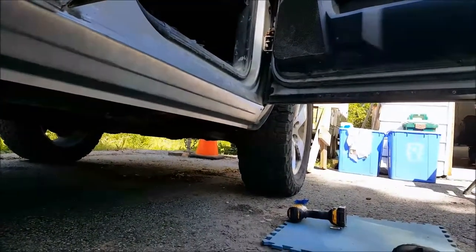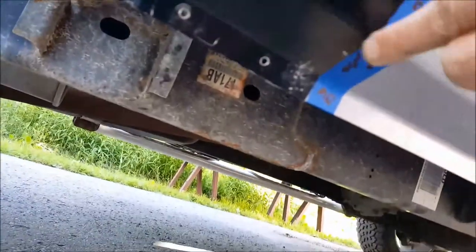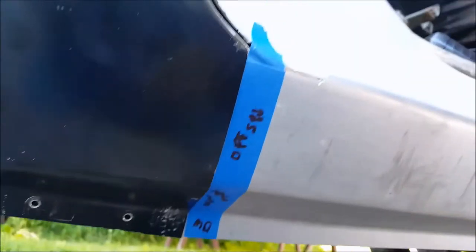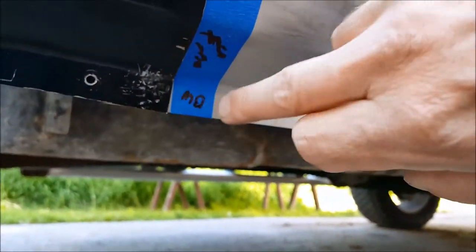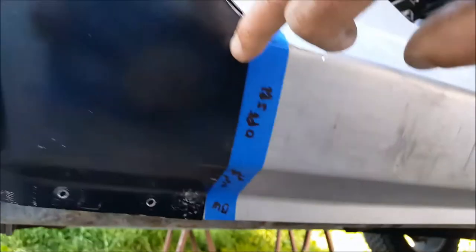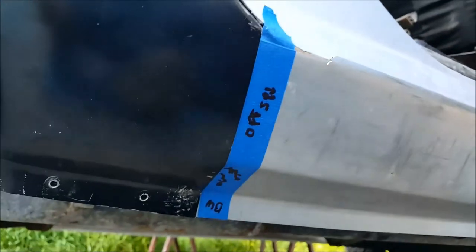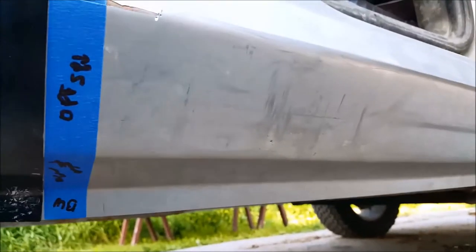Got this clamped in with a couple of vice grips about where I want it. I shot a screw in there to hold it up in place, which will also work as a temporary marker for the numerous times I'm going to have to take this on and off. I took two screws out of the back so I can open it up a little bit. You can see this comes down around this corner, so right about here I'm going to have to take this fold line out so I can slip this in behind the cab corner, then mark it and cut it off. The tape is the cut line for the offset - the actual cut will be about 3/8 of an inch this way on this piece, so that when I offset it the offset will end up just the other side of this tape line.